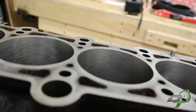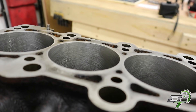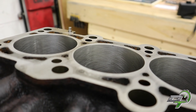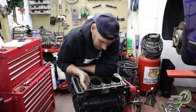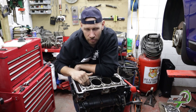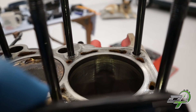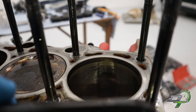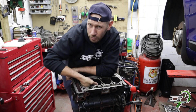What you end up with is a mixture of nice little troughs that hold the lubrication and nicely rounded-off peaks which have bedded in with the ring perfectly. That's the optimal look your cylinder should have for the rings to bed into. If your cylinder bores don't look like that, they are not in the optimal condition required for the rings to seat. On top of that, you need to get your fingers in there and assess if there's any wear or damage. With your hand inside the bore, you shouldn't be able to feel any irregularities at all. If you can see or feel a scratch, a gouge, or a little patch of wear — sometimes they show up as shadows — you need to consider measuring that bore.